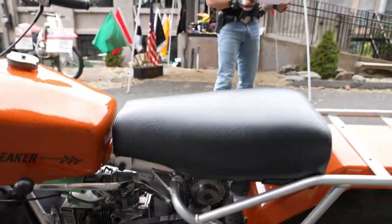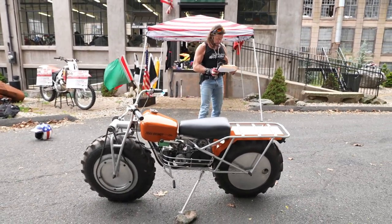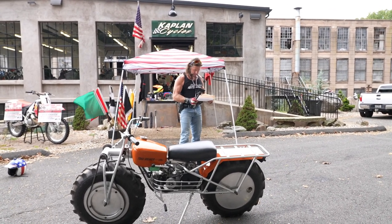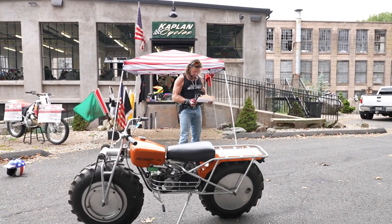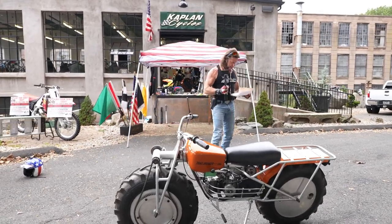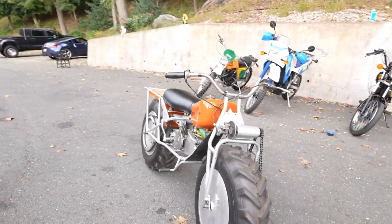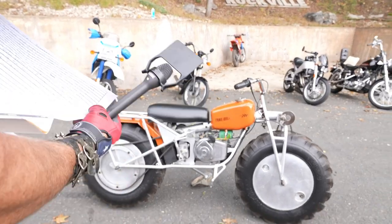Serviced upper front miter drive box with new gear oil, lubed and adjusted the throttle cable, cleaned and lubed the throttle housing, installed the updated air filter assembly, lubed the chains, set the tire air pressure at 4 pounds front and rear — very low pressure, as you can see it'll climb right up the side of the hill like nothing. Replaced the exhaust gasket. Test drove it and did a final dial-in of the fuel screws. Runs excellent. All three gears work. It's a semi-automatic — there's no clutch, you just shift. It was awesome. Jimmy had it for a total of 12 hours.